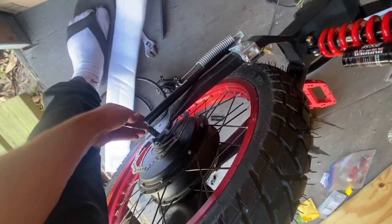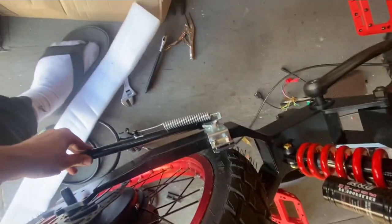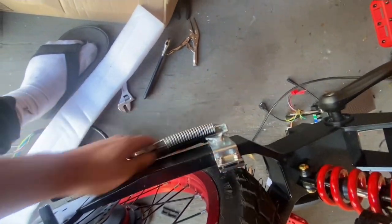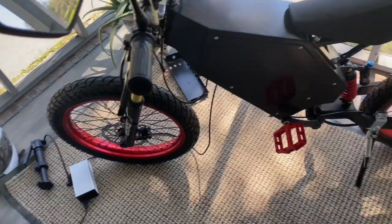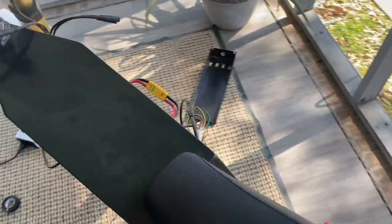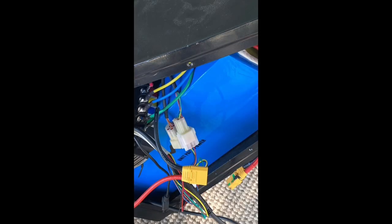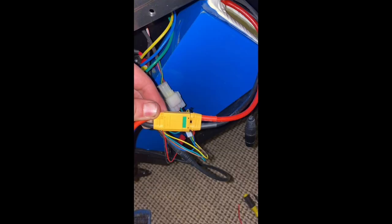See why we cut off that bottom part — no movement here. Make sure you've got a hole in the bottom of your bike frame to fit the motor wires through; I had to use a Dremel to make it bigger. Here's what we've got so far: the new motor is on, we've got the XT90 anti-spark connectors, and our connections are all here on the controller.